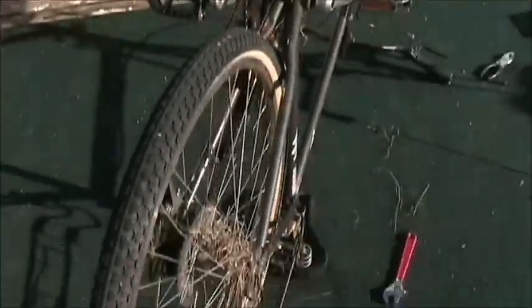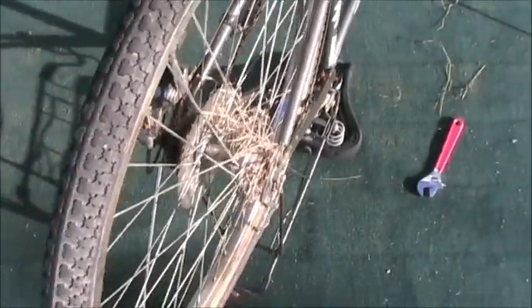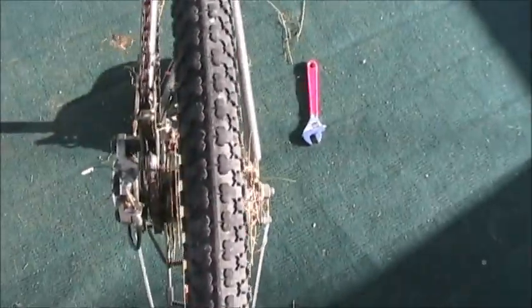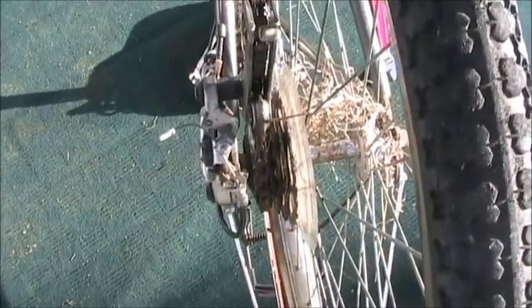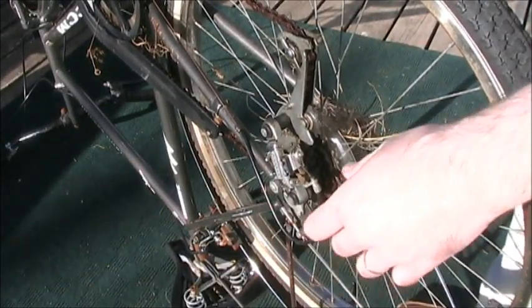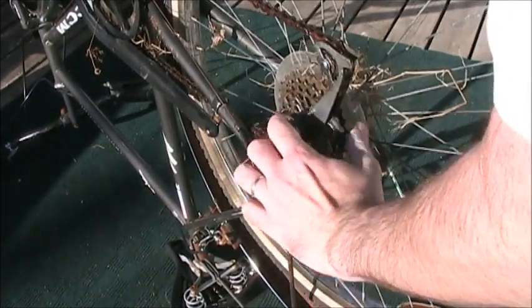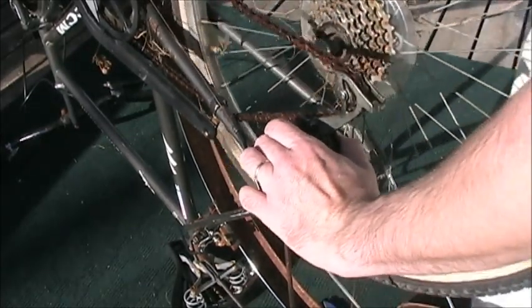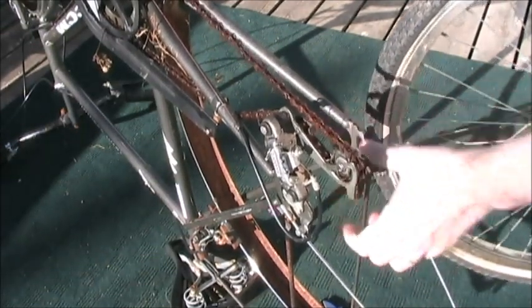Now that we have the front tire done, let's do the back tire. There's a lot of grass and stuff worked in here, but I think when we take off the rear wheel a lot of that will come out. It's pretty simple. Undo this bolt over here, undo this bolt right over here. And then remember this rear wheel has a sprocket on it, so we'll have to undo the chain mechanism when we pull the wheel off. Now that I have the bolts undone, you lift this mechanism back as best you can, lift the wheel out — don't forget to undo the brake — and then get it to un-cog so you can pull the wheel out. Don't mess around with this too much — we'll want it to put it all back together later.